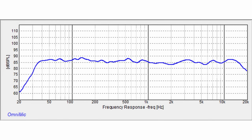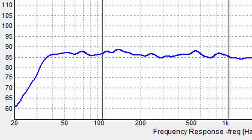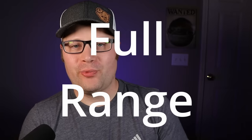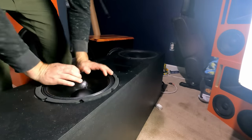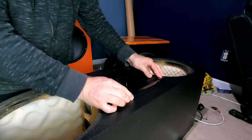When I powered these in-room, something interesting and exciting happened. Looking at the non-EQ response, I get in-room response all the way down to 40 hertz usable — and that's pretty exciting. After doing a little EQ work, I got these to go flat down to 35 hertz. When I hooked these up to my surround sound receiver, it auto-EQ'd them with its room EQ wizard, so I didn't have to manually adjust it, and its crossover point was 40 hertz. That makes these pretty much full-range tower speakers for the front soundstage, which makes a huge difference especially as a center channel, giving you the full range of sound for voices.